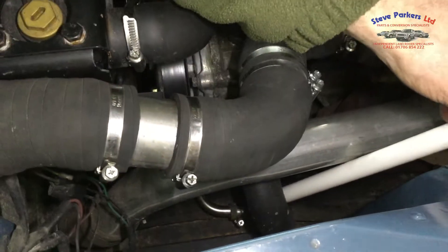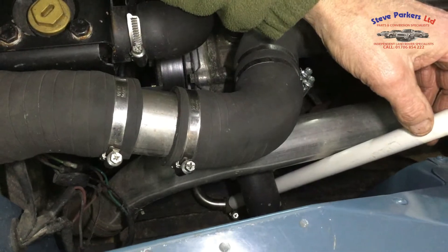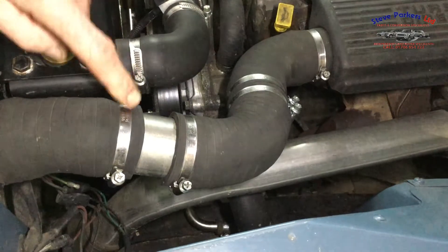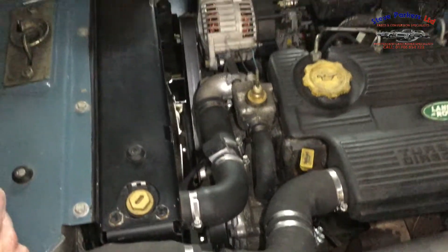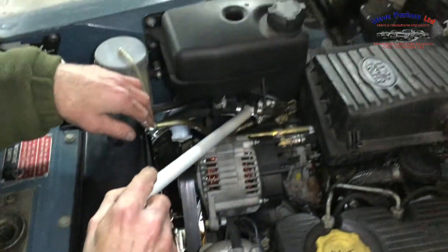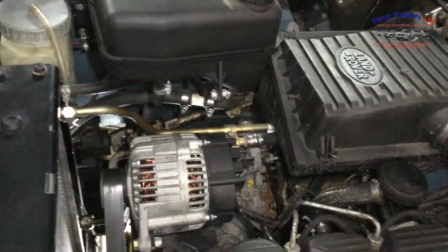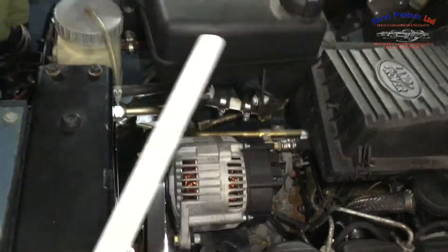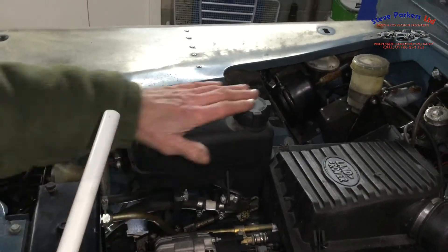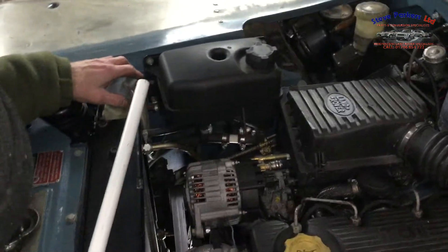You can just see with my pointer — that's the heater connection on the manifold. That's it on top of the chassis. The other connection now runs across the engine bay underneath the radiator, which comes up and then joins on that joiner to a 90-degree elbow which goes into the header tank. You can see the header tank is mounted there. You need to work out the distance for mounting — you mount it as high as you can to get a head on the cooling system, so it just clears the bonnet, the air filter, and the reservoir.